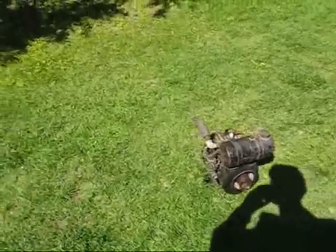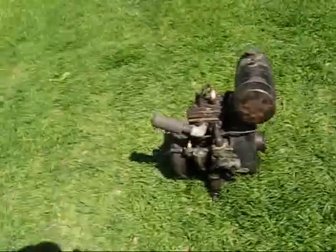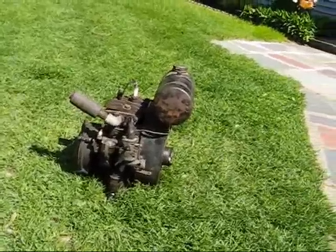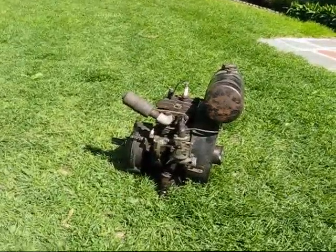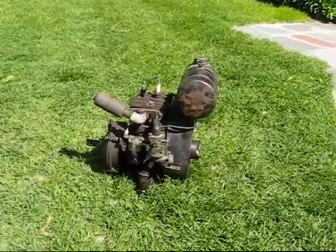It's alive! And it has almost no compression, but it's running. Well, it was. You saw it run — a little bit. I had the gas shut off on top of the tank, so it was just running a little bit. It turns out it's got a leaky gasket, bad rings. I didn't even mess with the carburetor.